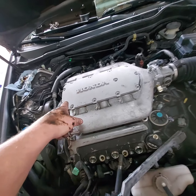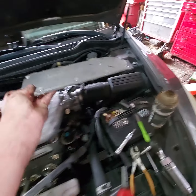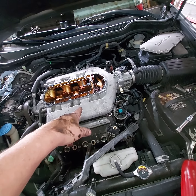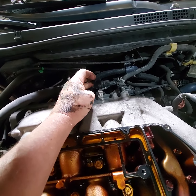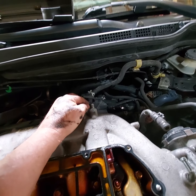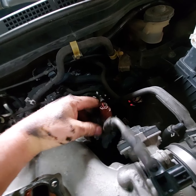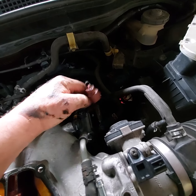We've got about 11 bolts there, we've got to take this cover off, and then nine or ten bolts for the upper intake, and that upper intake will come off. There's a vacuum solenoid here — I just took the bolt off, left everything connected, disconnected one vacuum line going to your brake booster. Took the two bolts that hold the purge solenoid valve — two 10mm bolts — and disconnected the vacuum line there because this line is fastened to that metal bracket.